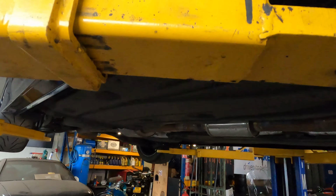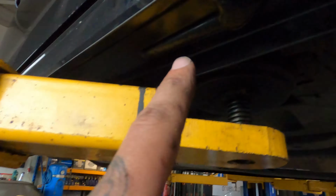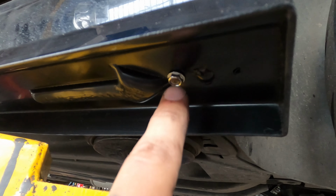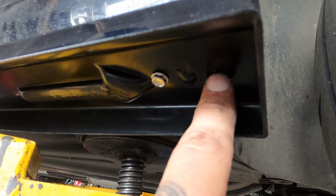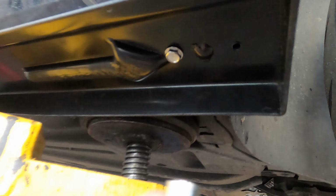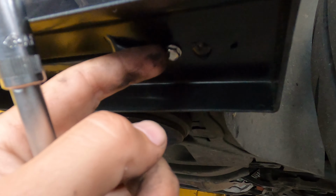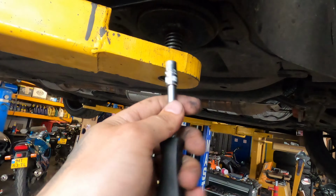Then I went to the back, I stuck it on, put a bolt in there, went back to the front, and I saw it wasn't aligned well, so I took that one out. Then first I drilled another one, a little bit in, took that out, moved this a little bit, and then drilled this in. Make sure the last bit you do by hand, so drill it with a drill till you have like 5 millimeters left, then do it by hand.